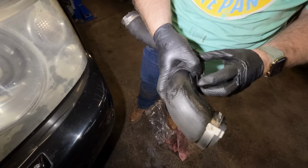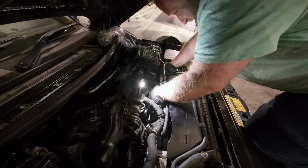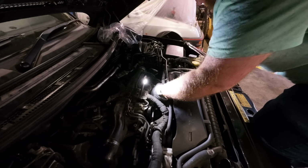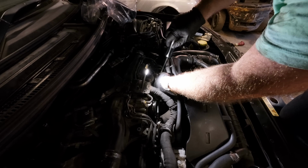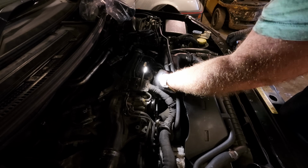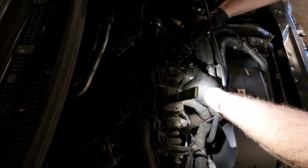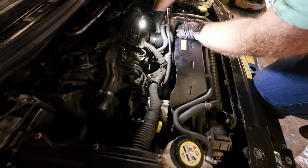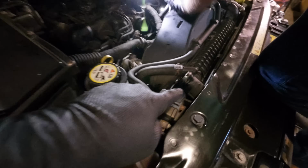Okay. Just on there. So we found the culprit for some of the black smoke we were seeing. It's not just minor. Liam's currently getting that boost hose on, and it's a proper pig. You got it on? Kind of. It won't go past the Jubilee clip. Yes. Well done, dude. There we go. Right, this one's off here, so we'll just get that one in.